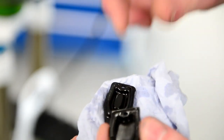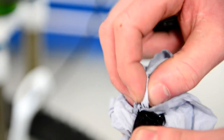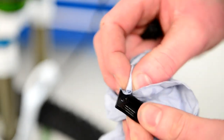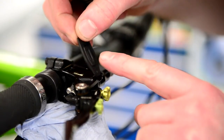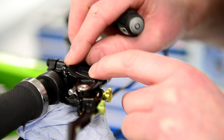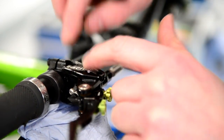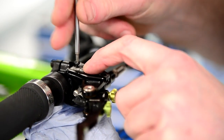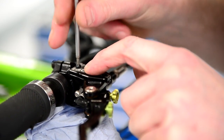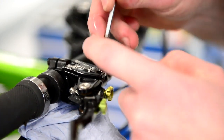Then remove your diaphragm from your cap, just making sure all the breather holes are clear, where the actual diaphragm seat is clear. Just wipe any excess away, any dirt that might be in there, and just have a good inspection of it. Then once the master cylinder is partly full, just roll the diaphragm in ever so slowly. We will be taking this back off, so don't panic — this isn't the final finishing procedure. Then just pop your T10 Torx screws back in.